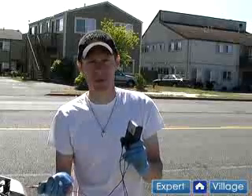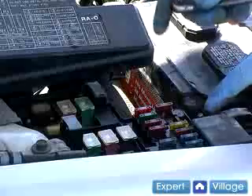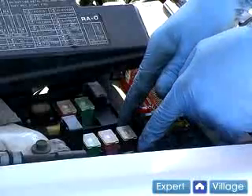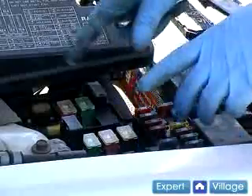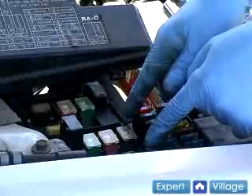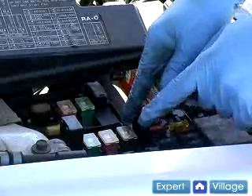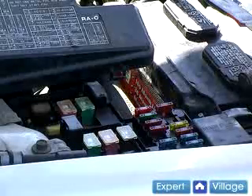Let's move on to the main battery fuse and test it. To test the fuse, we're going to take our meter and put it on either side of the fuse legs, which are screwed down into the fuse box. But if there's a battery connected to the car, there should be 12 hot volts at the fuse, which will burn our meter and give us a funny reading. So we need to disconnect the battery terminal one more time.